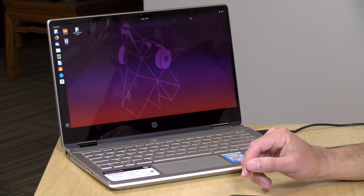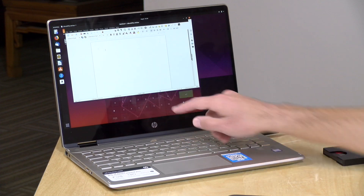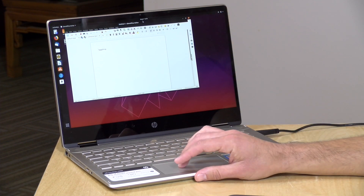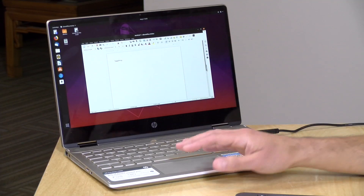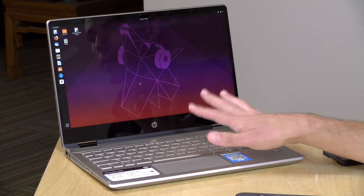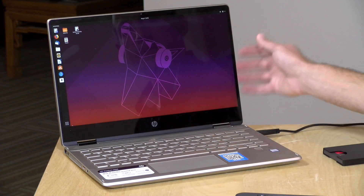We also booted up Ubuntu 19.04. Things seemed to work for the most part — video is working, the touch display is being detected properly, and you can type on the screen most of the time. It's a little glitchy but seems to be working okay. The one thing that did not get detected was Wi-Fi. Bluetooth worked, but not Wi-Fi — we've seen this on a few other laptops recently. There might be a driver available, but it won't detect out of the box. If you plan to run Linux, you may need a USB networking adapter, as swapping the internal Wi-Fi card is not easy on this machine.